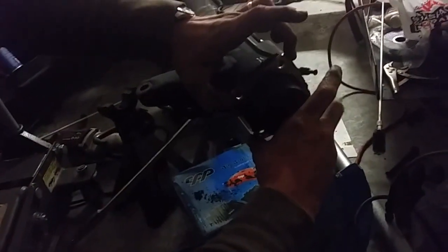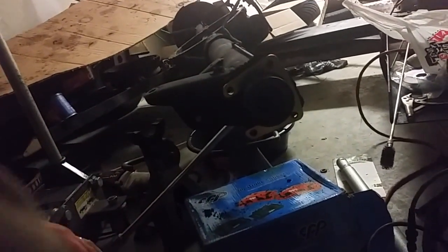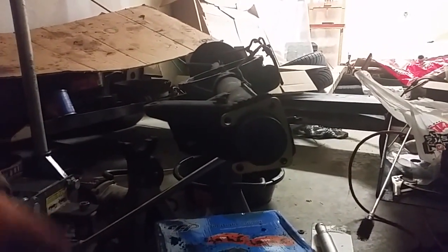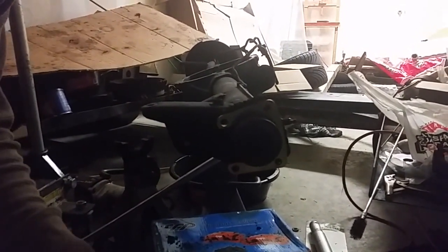The plates — if you notice — are the exact same bolt pattern as the '69 Chevelle SS axle. Also the exact same bolt pattern as the above-mentioned vehicles — 70s Novas, 80s S10s, 80s Camaros, anything. GM did not change their backing plate bolt pattern for a few years because changes like that cost money — you've got to invent new tools to manufacture certain things. When you're trying to sell a product, little changes like that don't need to happen. So you just thread the bolts in.